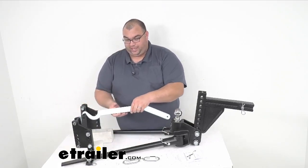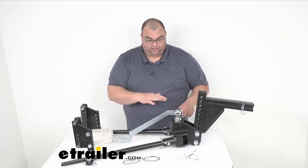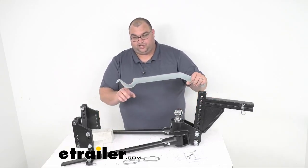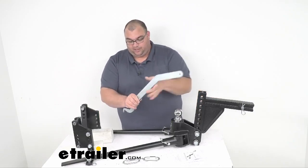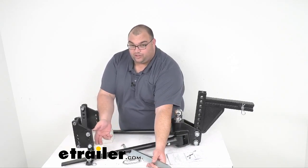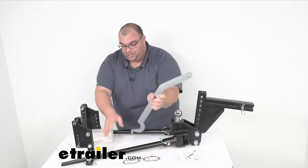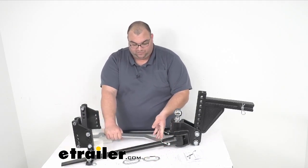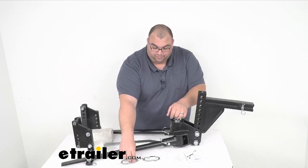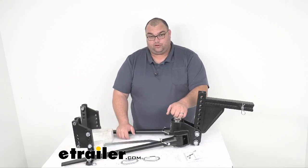It does come with a spring bar tool. When you're installing your spring bars, remember the trailer tongue is going to already be on here, and you're basically going to be putting the weight of those spring bars up in place on the L-brackets. This hook here would go over your trailer frame, and you would pivot it up using this tool and slide it onto the L-bracket, then put in your retaining pin to keep it safe. It also comes with two D-rings or links that you can tighten up — those are going to be on your safety chains. You always want to make sure you have safety chains on your camper trailer or anything you're towing.